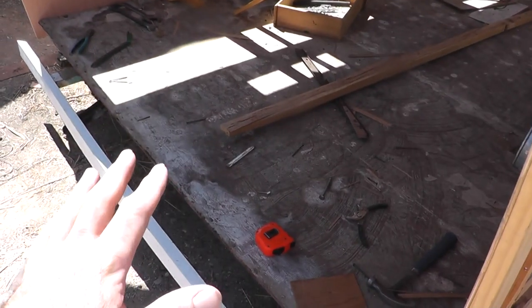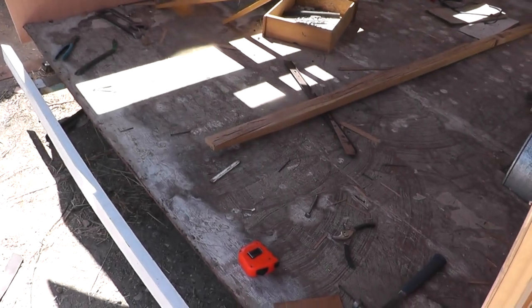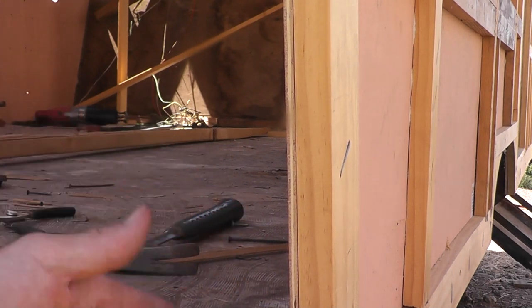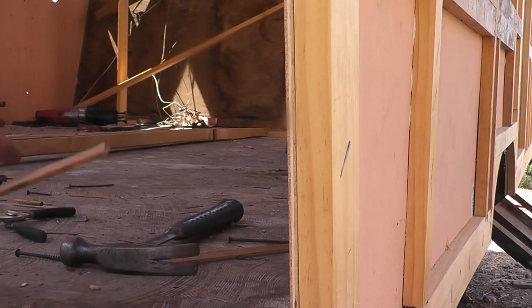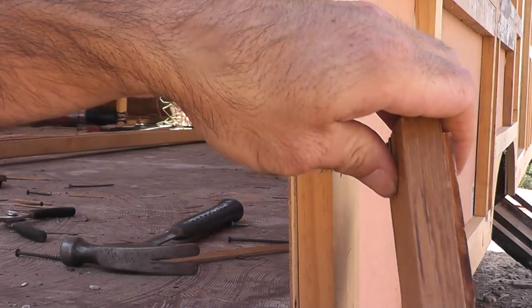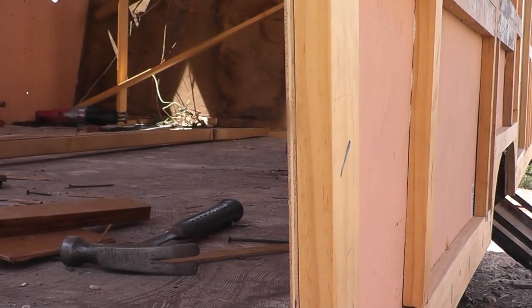Before I actually start building this rear wall, I need to make sure that the distance between the outside of this wall and the outside of the opposing wall is the same as when the camper was new. That way the siding will reattach without trouble. The framing lumber for my new walls is just a little bit thicker than the original, and the new paneling is also just a little bit thicker — so the new wall is about a sixteenth of an inch wider. The aluminum siding doesn't stretch, and I want this thing to go back together as smoothly as possible.